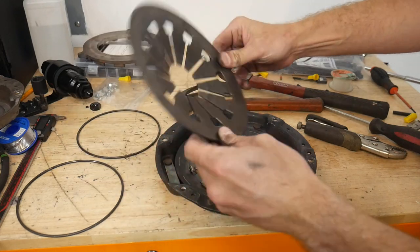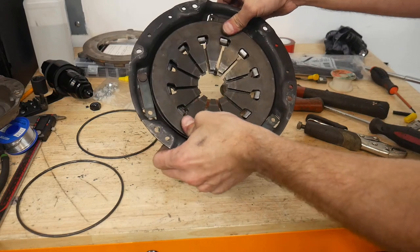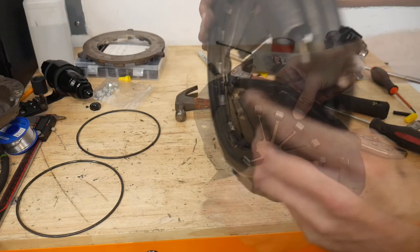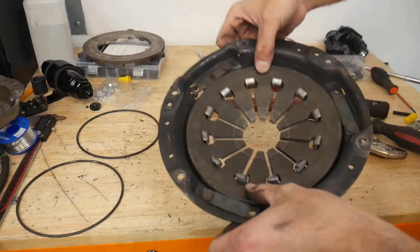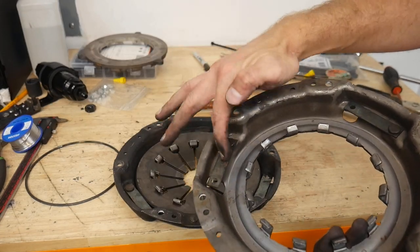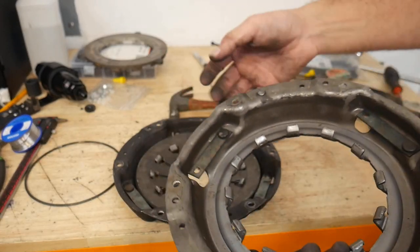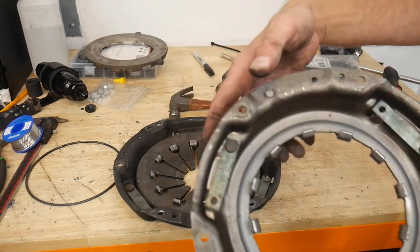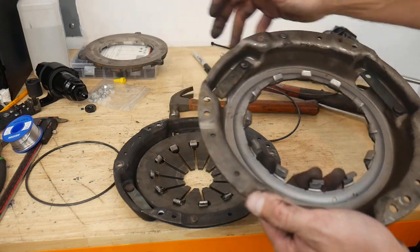So that's your clutch spring. Now we're going to take our second spring and add it to our existing spring — like so. Now we've got two springs, which means twice the clamping force. I'm going to go ahead and drill these out and use these straps — I'm going to use four of these. There are two little ones sandwiched together, and I'm going to use both of them on the new setup so I'll have four each, giving us a little bit more security in that section.